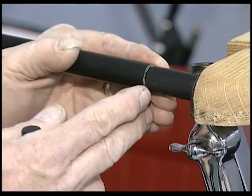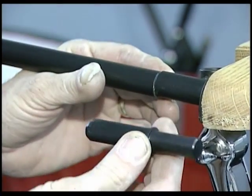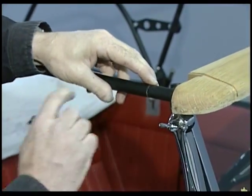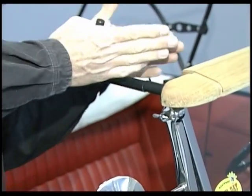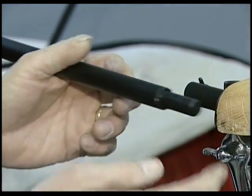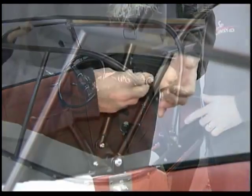As you can see, we got that cut just right. With our little tension up, it lines up just right. These are Delrin bungs so they have a little give in them — if your angle's off a little bit, you just want these as close to parallel as they can be. If they're off a little bit, it's not a big problem because there's some give in these bungs. So we're going to install this bung in here, raise this up, install it on here, put this all back together at this end, and go over and do the other side.